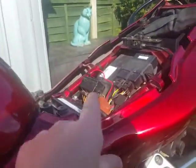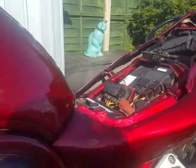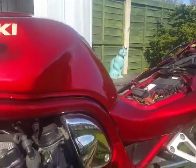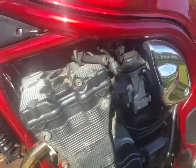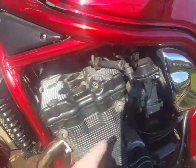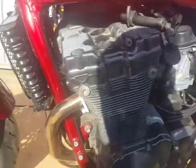Unfortunately on this bike, the ignition fuse — if you pull that, it cuts the power to the starter motor. So I can't turn it over without spark, hence the reason I'm going to have to earth these. It's just for safety. I don't want fuel and spark while I'm turning the engine over with the cylinders open during the compression test.